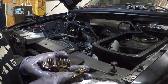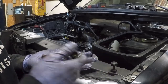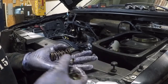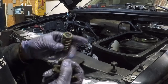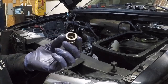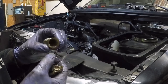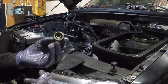This truck has a few more problems than what we thought. We've got one broken rocker arm, two broken rocker arms, three broken rocker arms, and a loose valve spring. For a valve spring to be loose like that, it means we've got a broken valve too. We're about to go a whole lot farther into this truck to fix it.